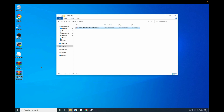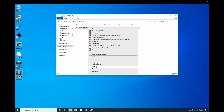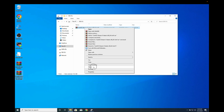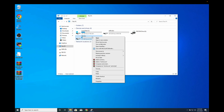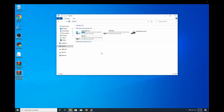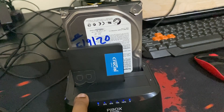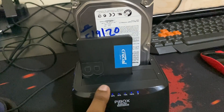Next, we'll check out the cloning operation, which is offline — you do not need any host to clone data from source to target. Before that, I'll quickly remove data from the drives and format them before starting the cloning operation. Make sure the target is greater than or equal to the source. In my case, the source is 240 GB SSD and the target is 500 GB SATA drive. Make sure your target device is large enough to complete the cloning, otherwise the operation may terminate.